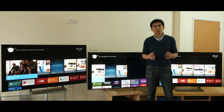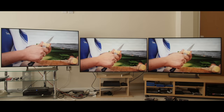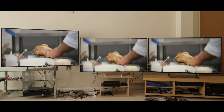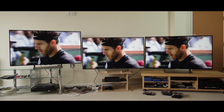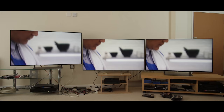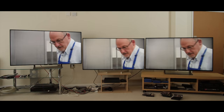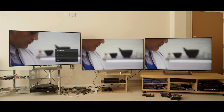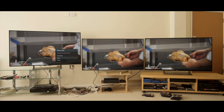The Sony XE93 uses a VA LCD panel whose response time is slower than those implemented on the XE90 and XF90, so dark objects moving across a lighter background may exhibit more smearing. Another thing to note is that the XE90 can be prone to frame repeat errors in 50Hz content. It's so quick that many people including owners may miss it, so I've filmed the following footage in slow motion to make it easier to see. You can see the frame repeat error manifesting as a slight pause in tennis footage. There are multiple frame repeat errors visible on the XE90 but not on the XF90 and XE93 as the camera cuts quickly from one shot to the next in Masterchef on BBC. To stop the frames from repeating, you can switch to the game, graphics or photo picture presets which probably disables the offending motion processing bug, but it's only a temporary fix, and we hope that Sony is working on a permanent solution.